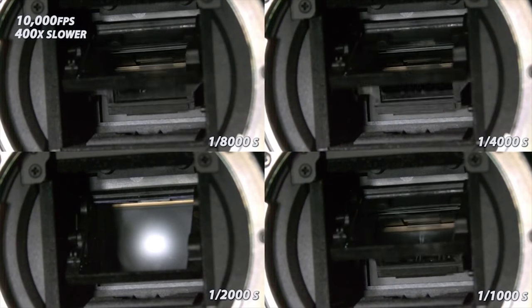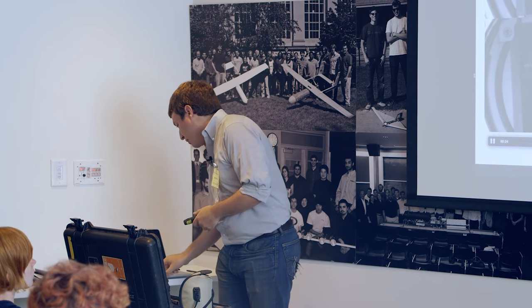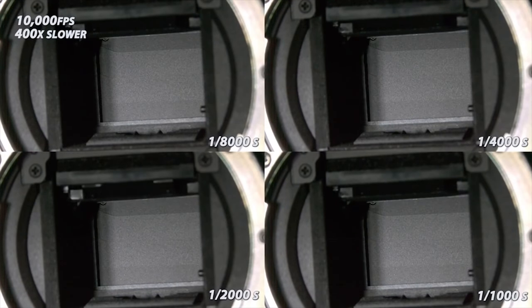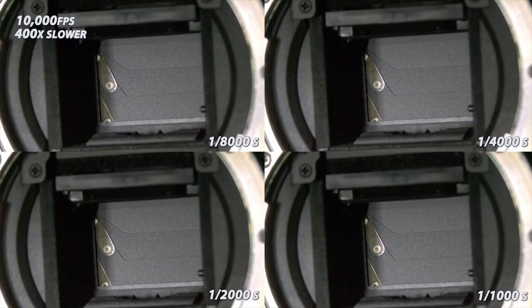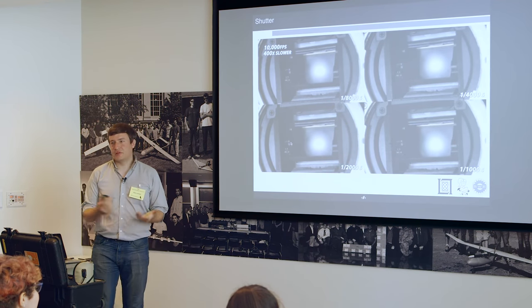Shutters — here's a video. They expose the imager to light and then stop, in very precise timing, same as film. We're watching this at 10,000 frames per second. Watch the mirror flip up — there it goes. These are different exposure times, so they let different amounts of light in. Watch the size of the shutter gap as it rolls by — one's much bigger, one's much smaller, letting much more or much less light in. Then the mirror comes back down. Modern DSLRs can do this 10 to 14 times per second, which sounds like a machine gun.